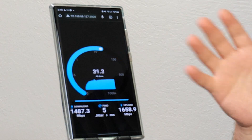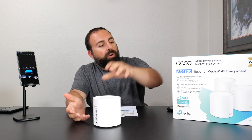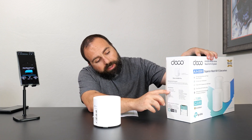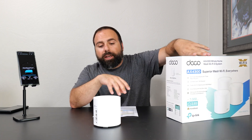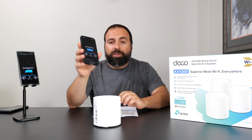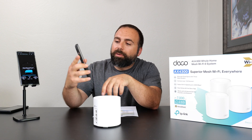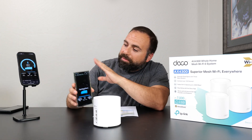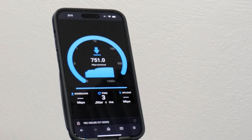It's just mind-blowing. The reason for that is because this router supports a 2.5 gigabit port, and because it's dual band it only has two bands — 2.4 and 5 GHz. But the 5 GHz actually supports speeds of up to 3,843 megabits — that's the theoretical limit of its speed rating, so it makes sense. But then I tried the same thing with the iPhone, which is just Wi-Fi 6, and the iPhone did not deliver — it's not going to get anywhere near the speeds that the 6E device got.